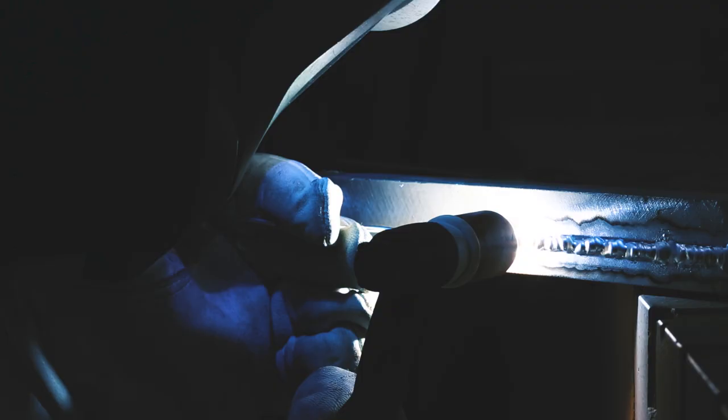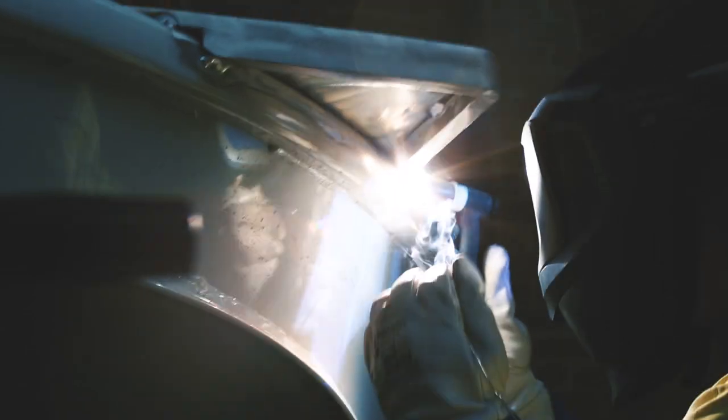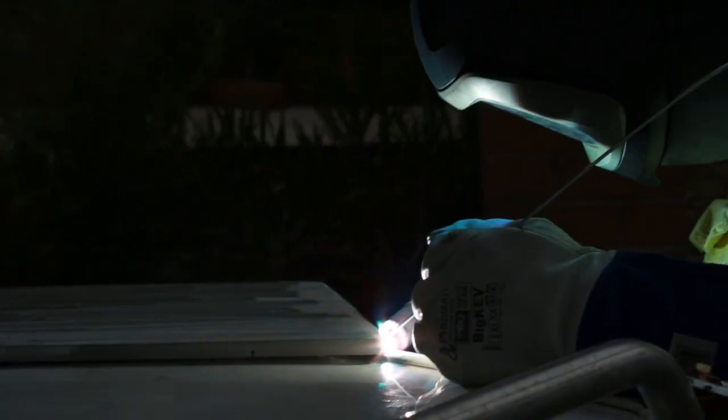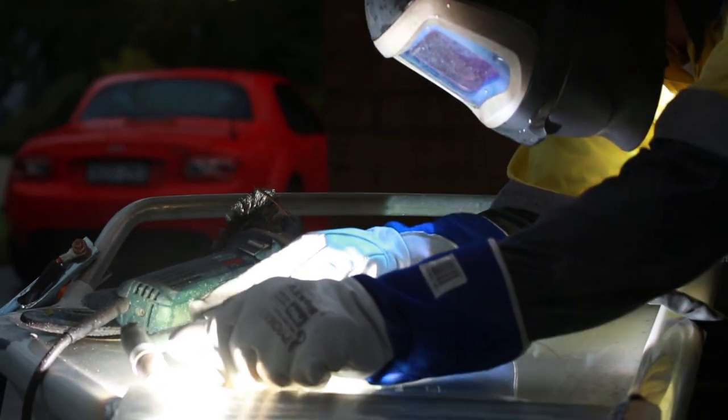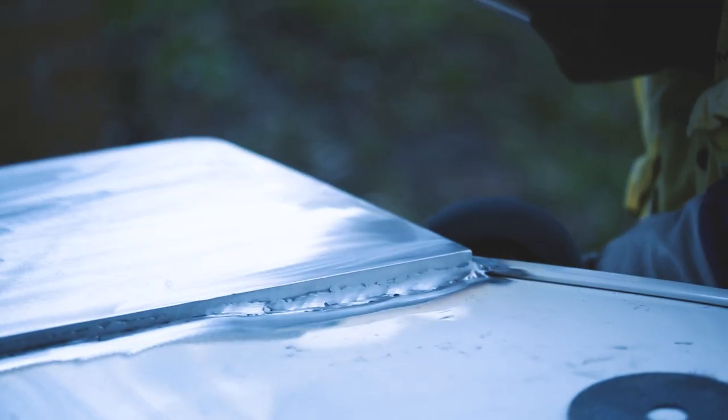After some more artistic b-roll of welding, the plate and perimeter were welded to the boat. The underside support was welded to the shear line whilst the plate was welded to the foredeck brace. Welding the thick plate to Dora's thin little foredeck was challenging even for Renard — the heat caused the thin sheet to warp and distort away from the plate, leaving a small hollow on the front edge of the bow. Instead of worrying about this hollow, we persevered ahead like people who just wanted to finish the job and go fishing. After a little more polishing, the welding was done.